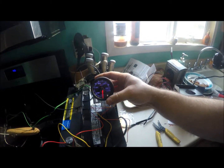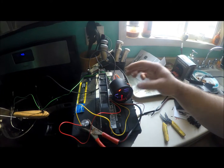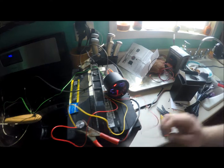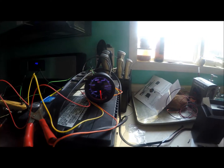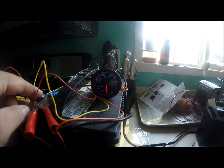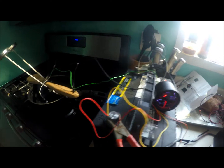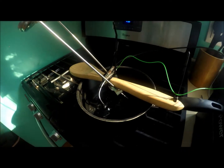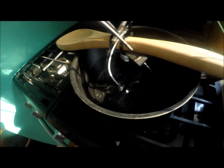I've got the gauge hooked up to a temporary battery source. There's a wire that dims the gauge — it can't do a constant dim, but if you hook it up to your headlights, when your headlights come on it will dim the gauge by 30 percent. Then it has a memory wire and an ignition wire, and the green wire hooks up to your sensor, which I have grounded back to the other side of my battery.